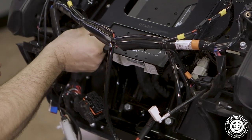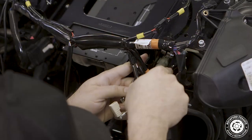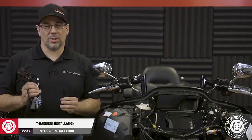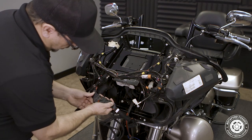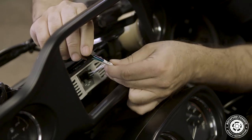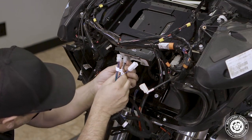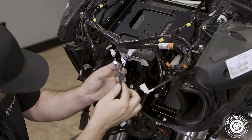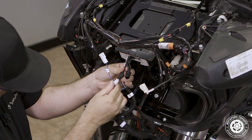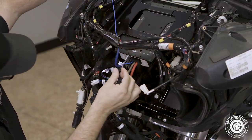Now we're ready to install our T-harness. First, take the harness that we removed from the source unit and plug it into the female connector of our T-harness — slide the lever closed until you hear it click into place. Then we'll take the harness labeled amp input and plug both into the corresponding front and rear inputs of the amplifier. Take the harness labeled amp output and plug both into the corresponding front and rear outputs. We'll also be using a Y adapter for installation of our tour pack and bag lids. Plug the harness into the power connector on the amp and plug the blue wire into the empty connector on the top of the brake side. This blue wire is the amplifier's remote turn on — take note that there's likely an empty plug that needs to be removed.